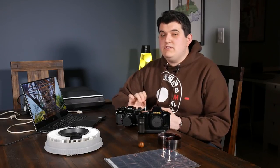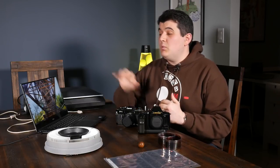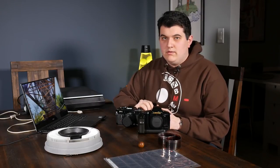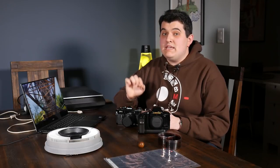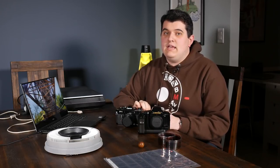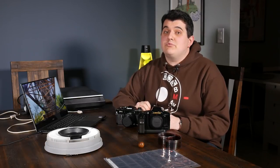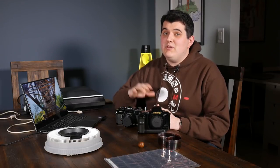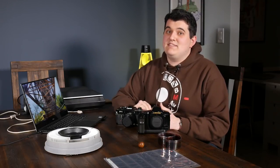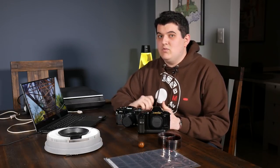The biggest drawback to using Digital ICE is that it more than doubles the time it takes to scan film, an already tediously slow process. Which brings me back to why this scanner is such an upgrade from my old one. The CCFL backlight of my old scanner required about a 1-minute warm-up between each successive scan when using Digital ICE, as the lamp would cool back down during the infrared scan. This made using it a real chore. A fully loaded film holder would take another 12 minutes on top of the more than doubled scan time needed for the second scan and image processing.